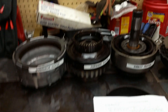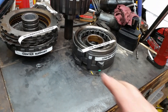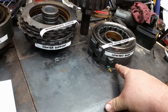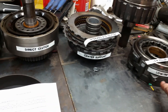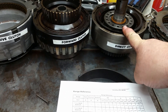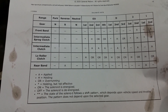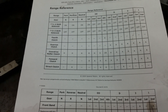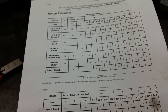You've got that labeled as a low and reverse clutch. Here's the thing — the low and reverse is only applied in manual first gear and in reverse. To get reverse, this band is applied and this clutch is applied, which gives you reverse. The point is that this chart is really a valuable piece of information — it can tell you a lot about how things work, what clutches are applied and when. If you're diagnosing one for a mechanical problem, that's what you want.